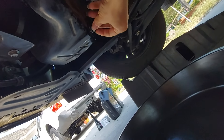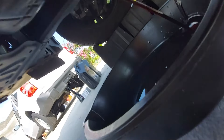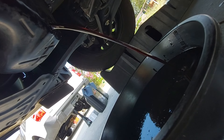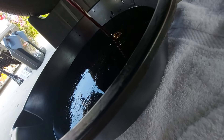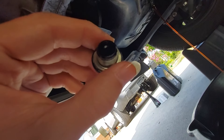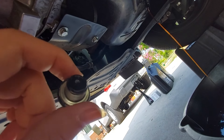Use your other hand to unscrew the bolt. Once it gets a little loose, you'll see oil start to seep. Try to lift the bolt upward into the pan as you remove it — that way it doesn't get your hands quite as dirty, though you'll still get dirty. You'll see the crush washer on the bolt; make sure you don't lose it. Keep the washer on the drain bolt and only remove it if you're replacing it. It's actually recommended to replace it every oil change, though I find every other oil change works fine.